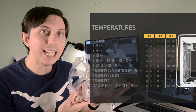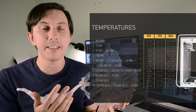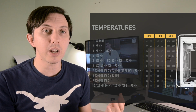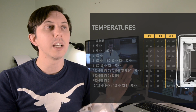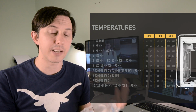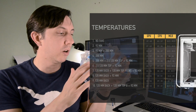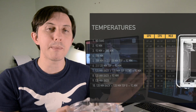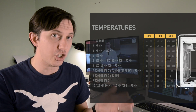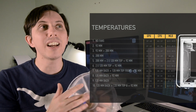And yeah, I'm losing the lighting, but I can eventually upgrade the 120mm fans with LED lighting fans. Also because I would like to upgrade to a PWM fan with a 4-pin connector to be able not to have to run the fans at full speed at all time, even though it's fairly silent, right? It's not as silent as I would like it to be, but it's fairly silent. So as you can see, I could have saved myself the money of buying this fan. And from a cooling point of view, with the fans just coming with the case, you can create already a very efficient airflow. So the lesson learned is not really straightforward.